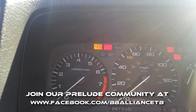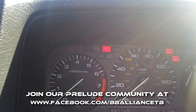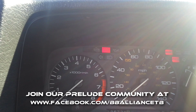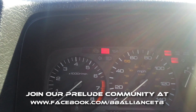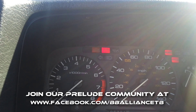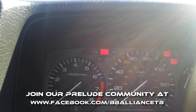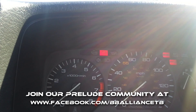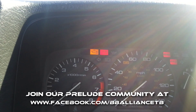Check the engine light: that's one long one — that's 10 — then one, two, three, four, five, six, seven short blinks. So that's ten plus seven, that's seventeen. Notice how the first one stays on for a while — that's the long blink for ten — and then seven short blinks follow. So my code is seventeen.